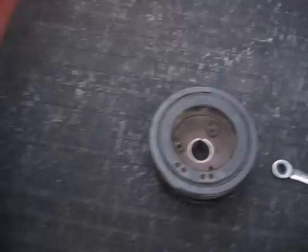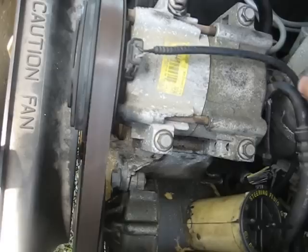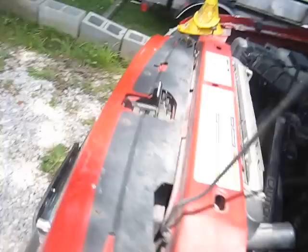We're going to go ahead and get this put back together. Let's bring you up to speed on what I've got done so far. I've got this bracket put back on, I've got the air conditioning system reconnected except for this wire that I'm going to have to reroute and tape to that plastic later. I've got my fan shroud in place. I'm getting ready to put it up on the radiator, but I've got to loosen the fan blade back up because it's not centered correctly.